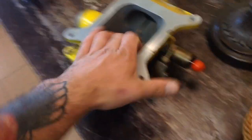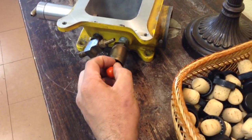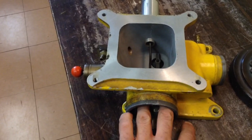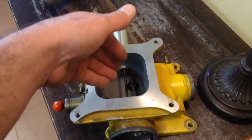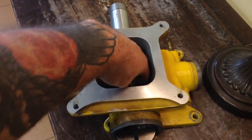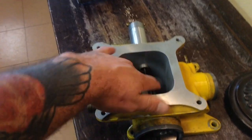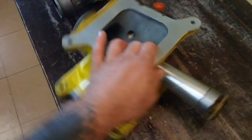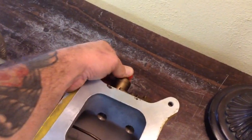And then the relief valve — how these function differently is because pressure has to be relieved from here. Otherwise there would be compressor surge and all that. Pressure doesn't typically happen in here, so something has to occur for an excess of pressure to blow this valve open. Or after you let off and these start to open, if there's just enough excess pressure — usually there should be a vacuum in a draw-through. If there is excess pressure, it's just going to blow off. You won't hear it like a blow-off valve, though. It's not like a blow-off valve at all, but it has a similar function.